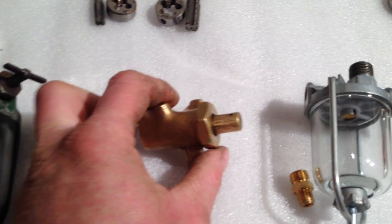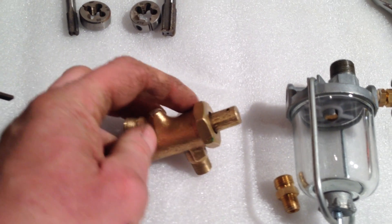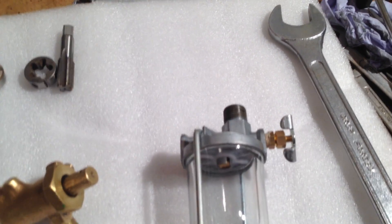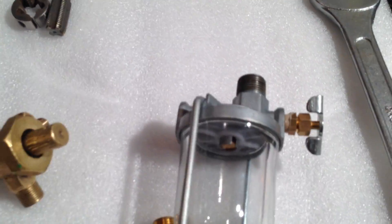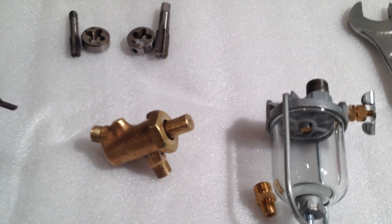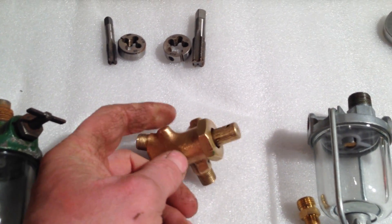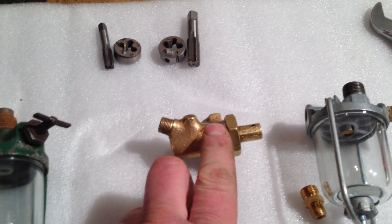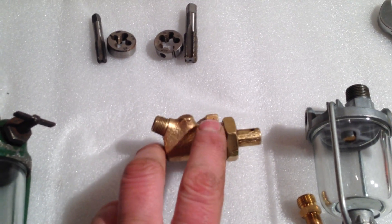Another thing I find with these three-way valves: this is an original and it's a good solid old valve, but it's a little bit worn inside and they don't turn off that brilliantly. That's why having a decent tap on the main bowl is important. I also put an inline tap on the fuel pipe from the starting tank — I haven't got one at the moment but I will be getting one soon — so you can really turn all the fuel off and not get any dripping onto anything. Obviously you always want to leave the drain valve open on your carburettor, because otherwise you have that fear of fuel ending up in the engine.